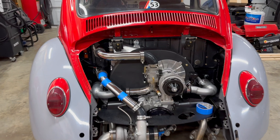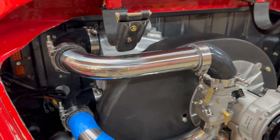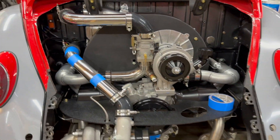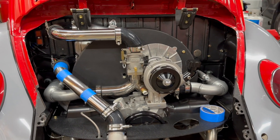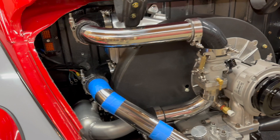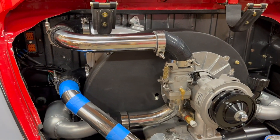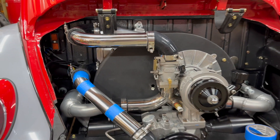So quick little mock-up there. The top pipe for the outlet of the intercooler to the throttle body — fairly easy, just a 90 that I had to cut the ends off. And then I had the turbo-to-intercooler pipe already mocked up. Really a pretty easy layout. All you need to do is finish welding this thing up and then work on the bung for the blow-off valve, and we should be good to wrap this one up.